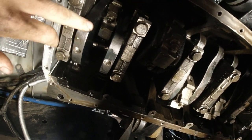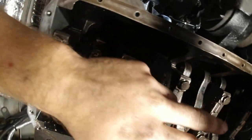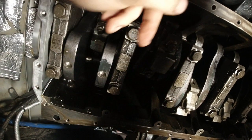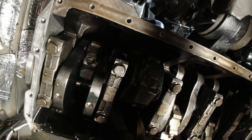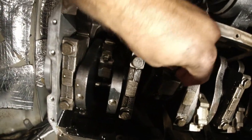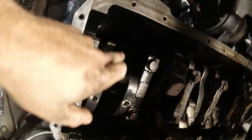The main bearings were brand new — the fellow I bought it from obviously changed them. But the rods definitely were not. The rods are pretty easy to change. For the mains, you push on a little bit with a screwdriver, spin it just a little bit, then use a feeler gauge. You can stick a screwdriver in the back side of the bearing and work it around since you're replacing it anyway. The thrust bearing is difficult — we had to spin the engine over while pushing on it. The thrust bearing keeps the crank from going front to back, and it's in spec for end play. The rods are also in spec for their end play movement.